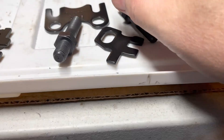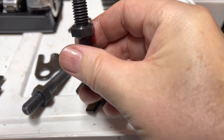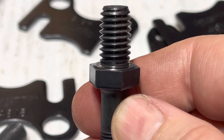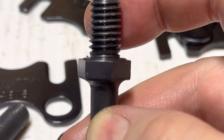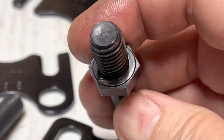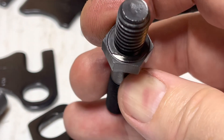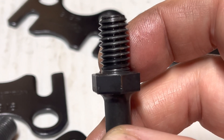When I ordered new studs, I wanted to get them for two reasons. One, these are kind of mangled here — see there on the left, there's a little piece sticking up. That's because it got gouged right into the pushrod guide, and every single one of the bolts is like that, even though these weren't really that tight. So there's just a little sliver waiting to pop off right there.